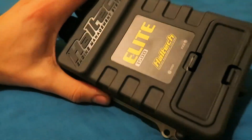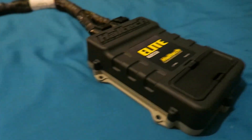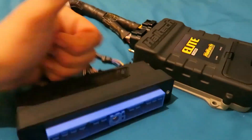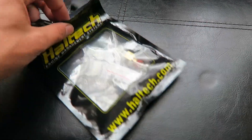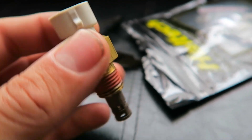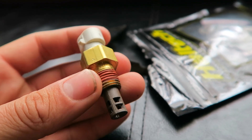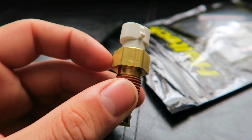It's like a composite material but it's very nicely made. All the logos are absolutely beautifully cast or engraved in - they're beautiful. That should make life a lot easier and obviously it's going to be a much neater install as well, so thumbs up for simplicity. The other thing I've got to work out for this install is the air temp sensor and where I'm going to mount that. It's just a little threaded sensor and it just has to sit in the flow of air in the intake so it can read the air temperature. By using the air temperature and the MAP sensor for the pressure, I should be able to run without a MAF because I can take it off the VE charts rather than a normal air fuel ratio chart.